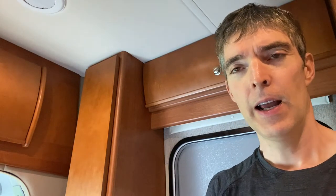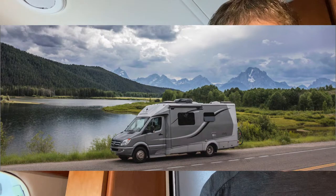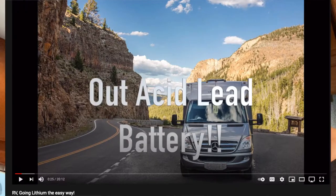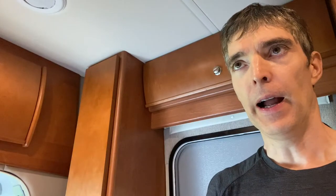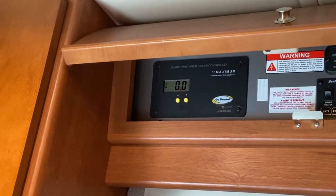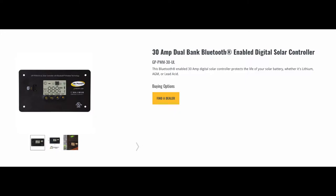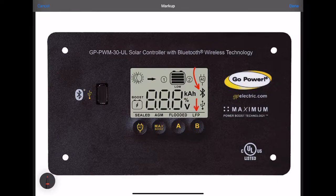Hi everyone, my name is Danny Grandin and I want to show you something I'm going to do to my Leisure Travel Van today. My unit is a 2014 Murphy bed. I switched to a lithium battery a few years ago and made a drop-in replacement, but kept most of what LTV installed initially, so the lithium battery wasn't used optimally. The problem with the old solar controller is an inability to top off the lithium battery because there is no lithium profile. I contacted Go Power and they told me their new model with Bluetooth and lithium support will be a direct replacement — so this is our project for today.